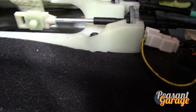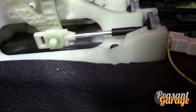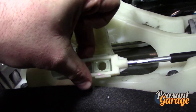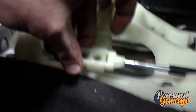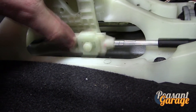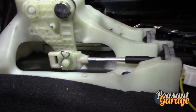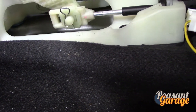This here is the adjustment for some of the shifting that goes on on the Hyundai. It would appear that over time there's wear in the cable assembly. What I've done is I've gone ahead and adjusted this - you pull out this clip, you pull this clip back, and you can see the factory markings. You can see there's a tab there and a tab there - I'm about a quarter inch off. You pull this back, slide it - there's some teeth in there - and then it grips. I actually have to pull back my shifter assembly just a little bit for that to fit back on, then reposition the clip and we've got first and second gear engaging nicely again. No bushing kit required - it's all adjustment.